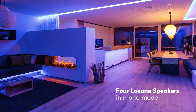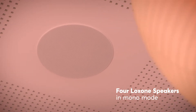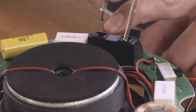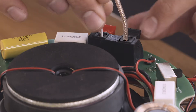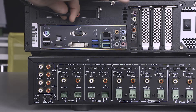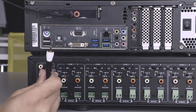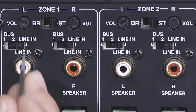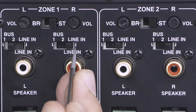To create perfect sound in a room larger than 45 m² we recommend using at least four speakers. Each speaker is switched to mono on the rear panel and connected with a speaker cable. The RCA cable is connected from the music server zone to the bus one input on the amplifier, then change both channels on the amplifier to bus one.